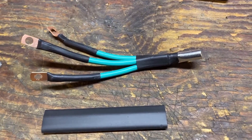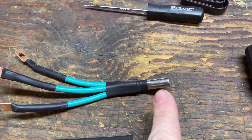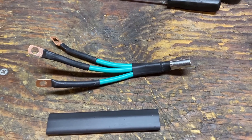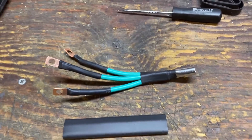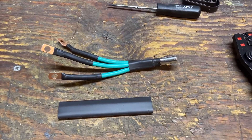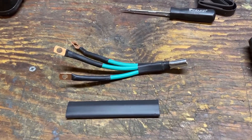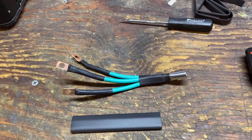Here we are ready to actually be installed in the battery. I'm going to slide this extra piece of heat shrink on there before I put it in, and I'll likely electrical tape this connection before I slide that heat shrink over once it's in the battery — just to be safe. In reality, this is about a dollar's worth of wire, a couple dollars worth of heat shrink tubing, and a couple dollars worth of connectors. If you don't have this stuff, bypass harnesses are available from companies out there for about 25 to 30 bucks, and it's probably worth spending that. But if you want to learn how to do things and have some tools laying around, this is a really easy DIY project.